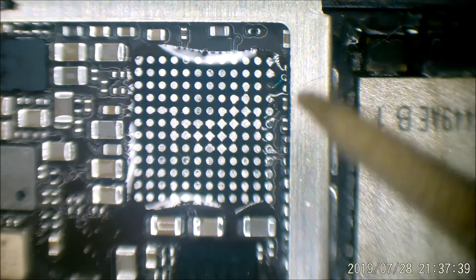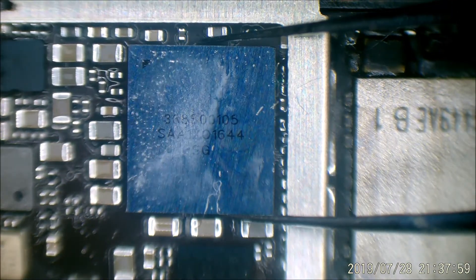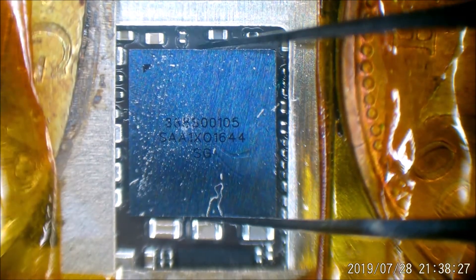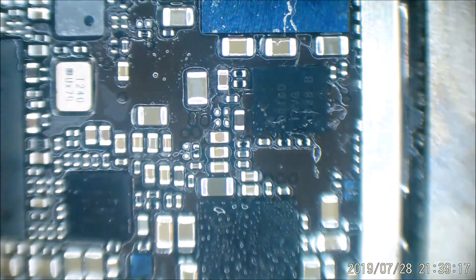Get flux on every little pad. It goes without saying — always make sure your chip orientation is right. I always like to use this little heat shield I've made from an iPhone screen back plate with a couple of coins stuck on it. It helps prevent getting a lot of heat on the NAND which is right next to it, or disrupting the chip just below it, and tries to keep the heat more centralized in the middle — because you don't want it going crazy and damaging the baseband on the other side.